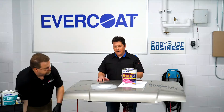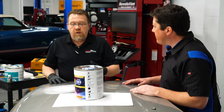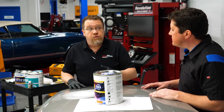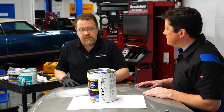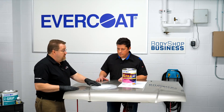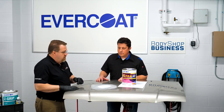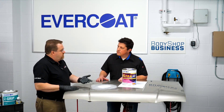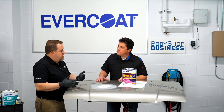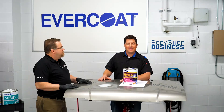I've seen repairs that are darker blue and lighter blue. What's up with that? If they're darker blue, that means extra cream hardener was added — it's over-catalyzed. If it's lighter blue, or worst case you see no hints of blue at all, that tells you it's radically under-catalyzed. We're going for that light soft blue color. Each of our products may start as a different color, but when you add the blue hardener, we always want some degree of blue showing up in the repair. Tim, thank you so much for your time today giving us this great information on troubleshooting tips when applying body filler. I'm Jason Stahl — thanks for watching.